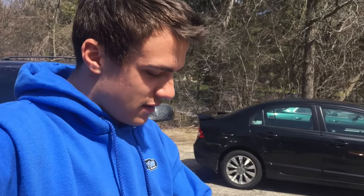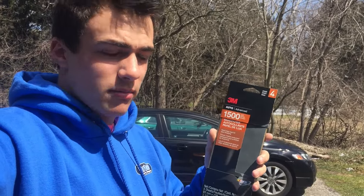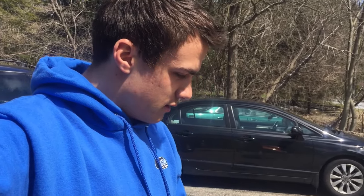But anyways, we're going to wet sand this with 1500 grit sandpaper. And then after that, we have to take a cutting compound and buff it, and then we're done. So, yeah, you guys are just going to watch me the rest of the time. So, kind of boring, but it's the rest of the video, and it's part of the process. So, let's get to it.